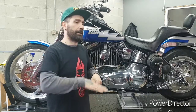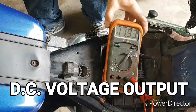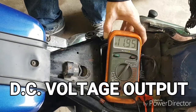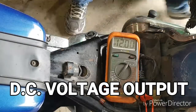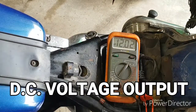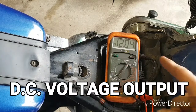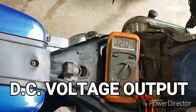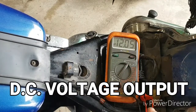First check: DC voltage — rev the bike up, you want to see an increase. That's a fast quick-and-dirty check to give you an indication of whether the charging system is working. With the motorcycle running, if the DC voltage did not increase, we know the charging system is not functioning correctly. Next we'll go down and check the stator for AC output to see if we're getting proper AC output from the stator, in which case we would suspect the regulator rectifier is faulty and replace it.